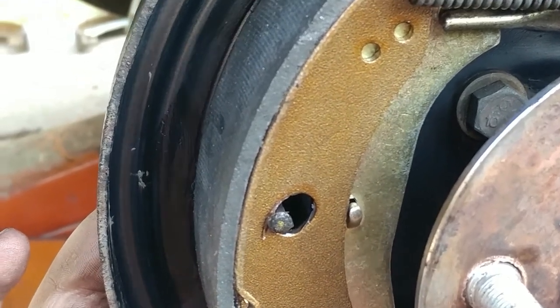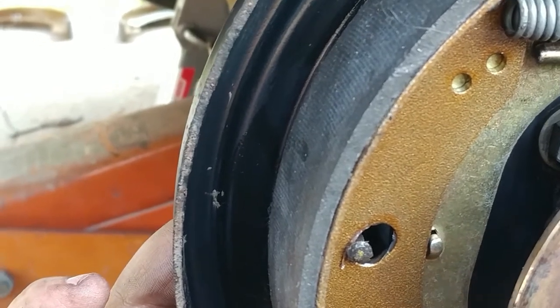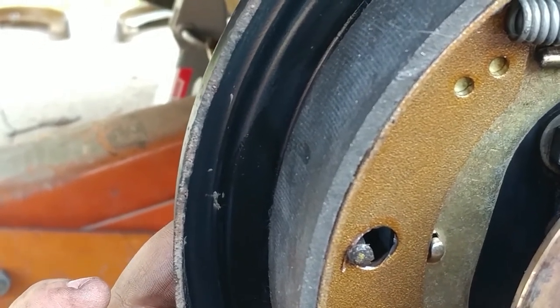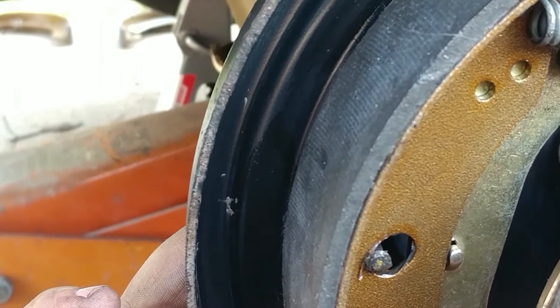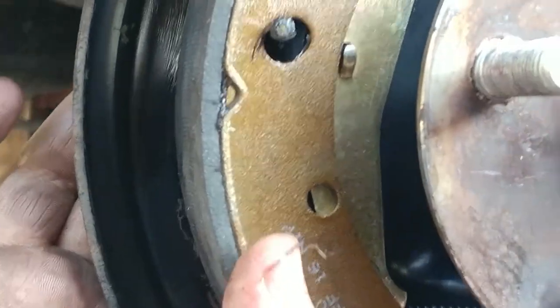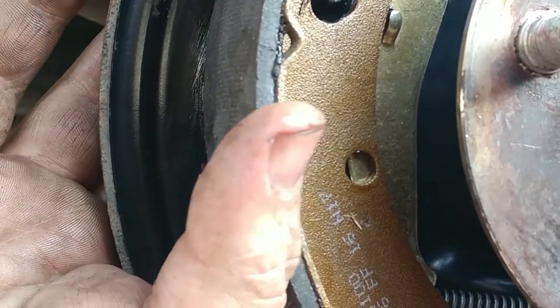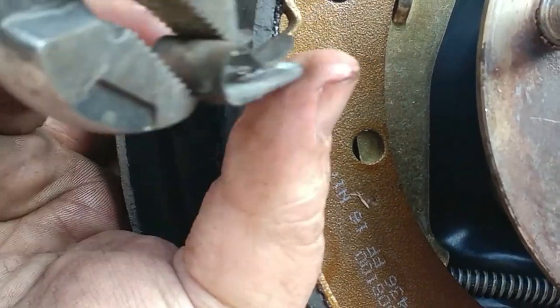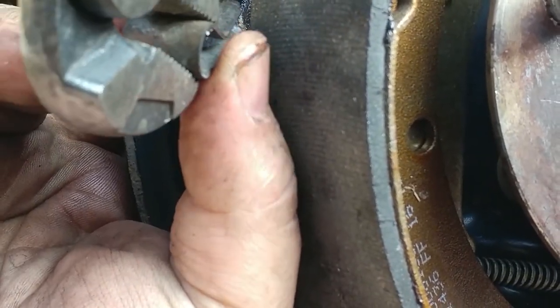I was gonna say, is there any like sounds that you'll hear while you're driving? Like how some people got those really loud, that's obnoxious, actually, squeaky brakes? To be honest with you, that is too late. And that's front brakes. If you're waiting until your brakes are squealing, you're metal to metal on the rear brake. On the front brake, however, it's your warning shot.